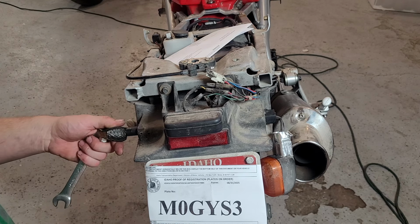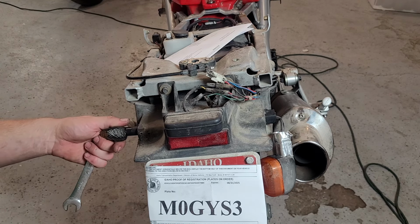Move that in. Yep. So yeah, a little dinky looking, and I don't love the smoked look, but $7, can't beat it. We may need to put a load resistor in parallel with this, because normal flashers, when you put LEDs on them because of the light load, tend to blink really fast. But we'll cross that bridge when we get there. Ah, dang it. Of course, these are opposite. The lights are female, the plug-ins are male. So we're gonna be doing some cutting and soldering.